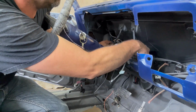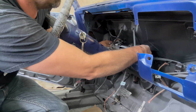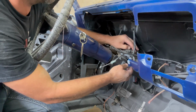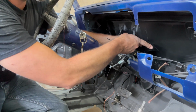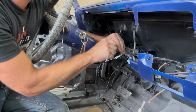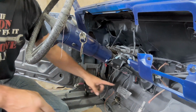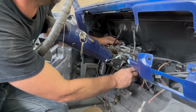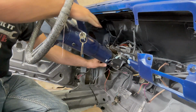I've got my speedo cable in the way. But this all goes on that side. Now, if you are really super sharp, this is a speedometer cable. You'll see it's going through the firewall right there above the heater box. This is typically the location for manual transmission cars. This is clearly an automatic. Got an automatic shifter and only have 2 pedals, so that ain't no manual transmission. But that's where the car was configured when I took it apart. I thought it was strange, but figured it's how it was. That's how we're gonna put it back.